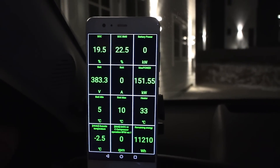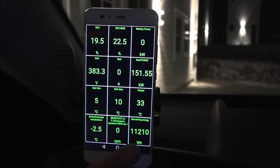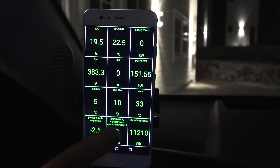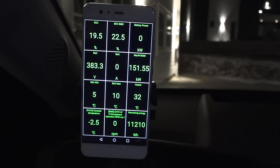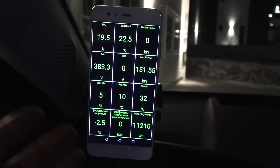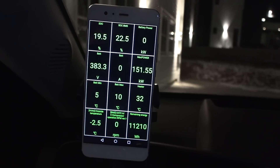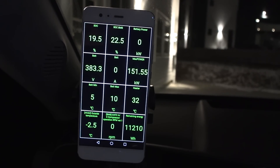I disconnected and I want to see the numbers. We have 19.5% there. This display is slightly incorrect — when you charge to 100%, it shows around 63 kilowatt hour for my number, but it's supposed to be 65. So these are the starting positions. I'm going to connect again and see how inefficient it is to charge like this. It's actually similar to Model 3 — it has to cycle the battery heater on and off to keep the battery warm enough to charge. Even at 5 kilowatt it did the same thing.